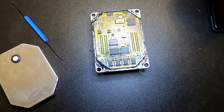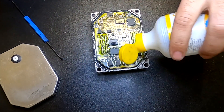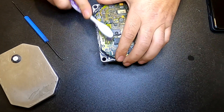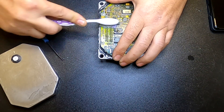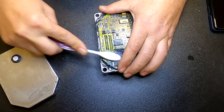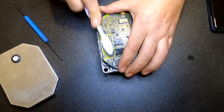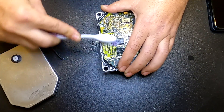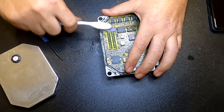These are the pins for the plug in this ECU, and these are the most common problems in these cars. They are mounted on top of the engine, and the vibration and heat of the engine cause these pins to crack the solder points, because when the metal gets warmer it expands and when it cools down it contracts.